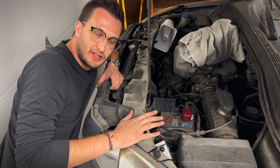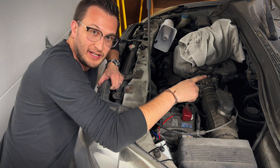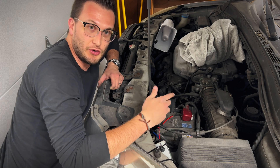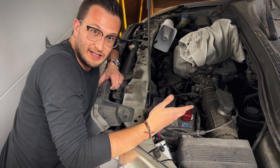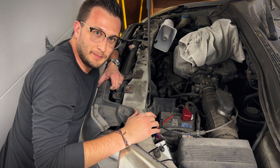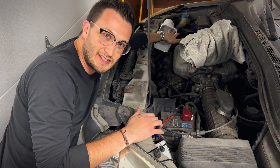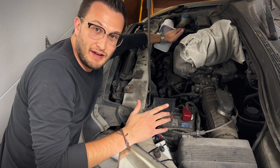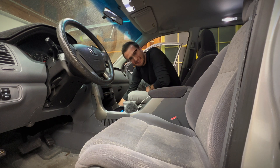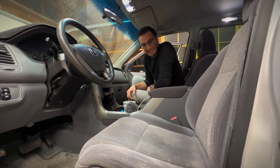I'm done with the bulk of the work in the engine bay. I've got this relay here that'll be triggered by two wires coming from the electronics inside the cabin. It's hooked straight up to the battery, but we're using this relay so there's no draw on the battery when we don't need the siren. The siren is mounted over there — the only place I could find to put it. Because it's 2:45 a.m., I'm going to put this towel in front of the siren so we can't hear it as loud. I'll close the hood and I'm sitting on this side so I have access to the switch to turn it off.